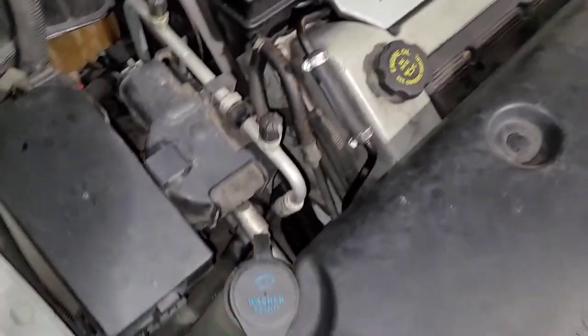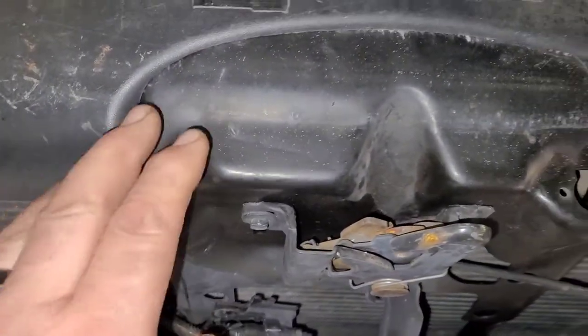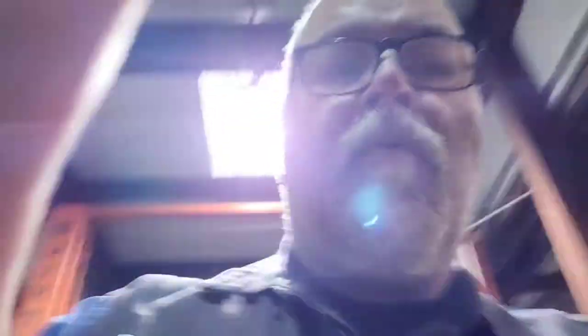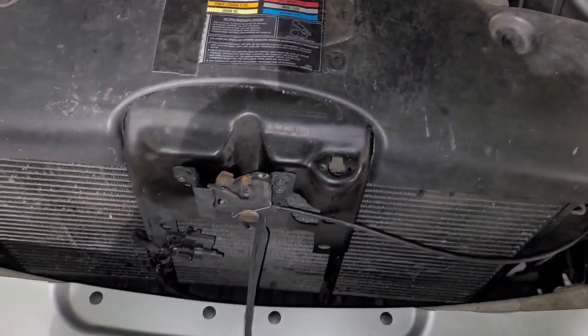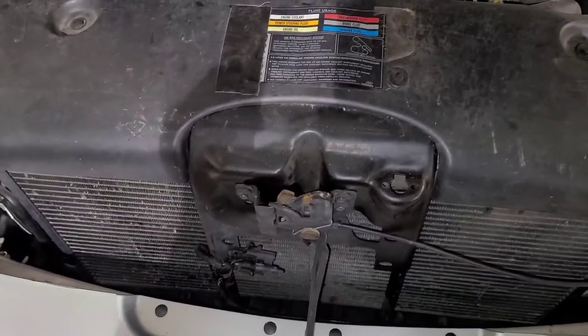AC is recharged, so that's all good to go. If you guys ever do one of these — and I learned this the hard way — this bracket is like a big C-shaped bracket that wraps around. Once you unbolt it from underneath and unbolt it from up top, once you unbolt the radiator and lift it up, you have to slide that C-channel bracket assembly out towards the driver's side. Slide it out towards the driver's side and then it'll come up and out. Otherwise what happens is it winds up hitting a bumper, because this bracket assembly has to come this way and it just channels in too far on both top and bottom. I lift it up on this side, got it up just high enough, and I was able to slide the thing in place. I don't remember doing that on the last one I did, but it's been a while. I think I may have installed that on the other ones, or taken it out at the same time, with the radiator and condenser.